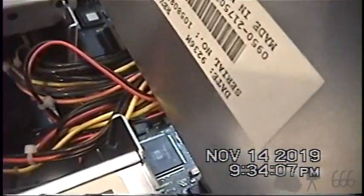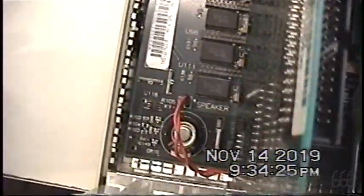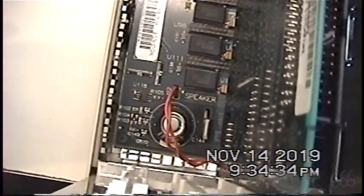Somebody was mentioning, I think it was NJ Roadfan, that most of these EISA systems use Dallas real-time clock modules, but I can't say as though I've actually found one, either on this one or on the other one. I haven't really looked totally at every little piece of the board, but I'm really starting to wonder if that is it. I think it is, and I think that's a capacitor, and that is what is used to hold the date and time settings as well as the real-time clock checksum.